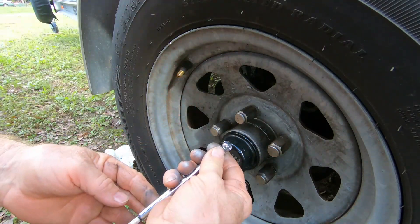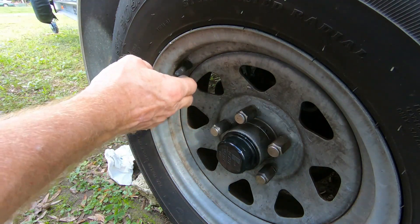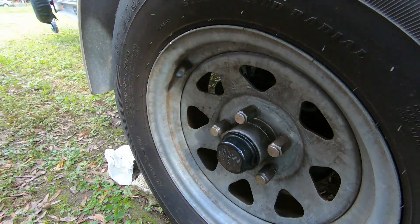As you can tell, we've got three more lug nuts to do on each tire. I checked my air pressure — these are at 40 pounds. Cold pressure is supposed to be 45 pounds; I like to do just a hair under at 40. I hope that was helpful for the maintenance of your tires and bearings. I have a link in the description for the Dexter caps in case you have a Dexter Vortex axle and hub so you can order some replacements.